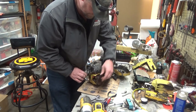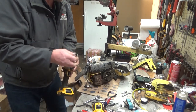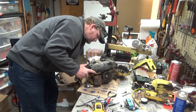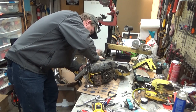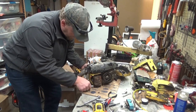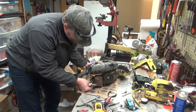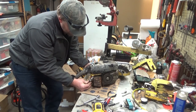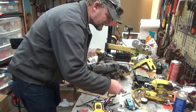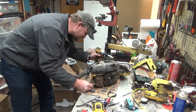All right. I'm going to hold this like that and assume that you guys are going to be able to see it. So I don't want to dick around with moving that camera around again. Make sure we're on. Flywheel nut wasn't even tight. I'm going to have to go through this with a fine tooth comb. Not enough spark to trigger the proper tester. So we'll see if it has enough to trigger just the spark plug out of the cylinder.